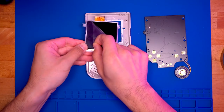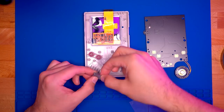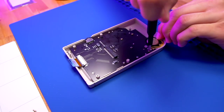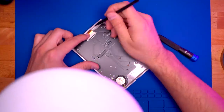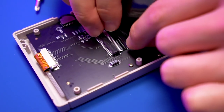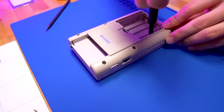Now it's time to put it all together. Go ahead and place the IPS panel with the bracket into the front shell housing, along with all the buttons and membranes. Followed by the PCB next, and secure it in position with the 8 remaining screws. Connect the IPS ribbon cable to the PCB and lock it in place. Then connect the provided ribbon cable between the front and rear PCB with the metal connectors facing up. Sandwich it all together and button it up with the 6 remaining screws.